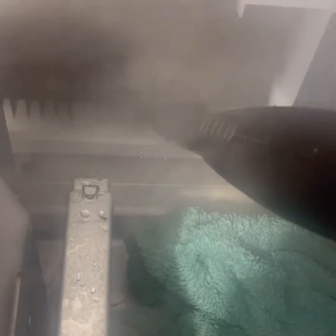And a clogged drain can mimic a defrost issue, thermistor issue, sometimes even a board issue. Put the unit in diagnostic, make sure that everything is functioning before you start replacing parts.